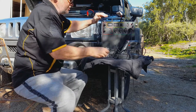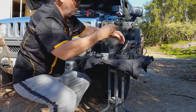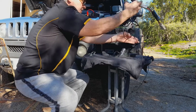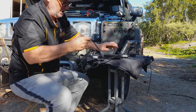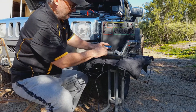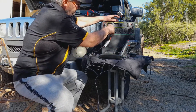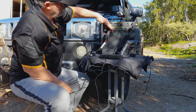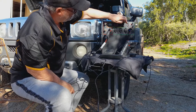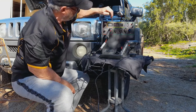Now what I want to explain is that if it's charging from that inverter and I pull this out of the inverter, it will now also be able to be charged from the 240. So I plug into 240 — it's putting out exactly the same as what's coming out of the car battery through the inverter. Plug it in here and it's now charging. The unit doesn't have to be on, it can be off and it's still charging. Let's put it on anyway. I'll take these loads off and I'll show you why in a moment.